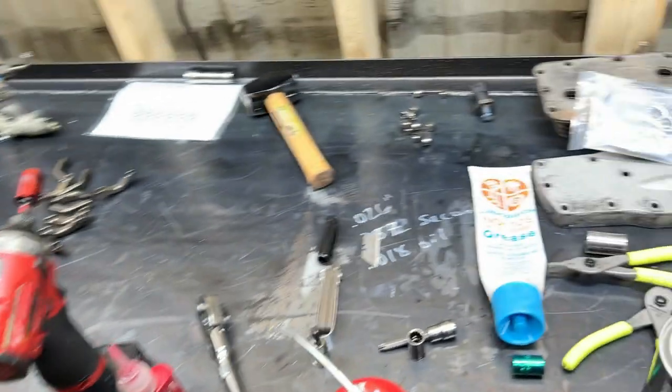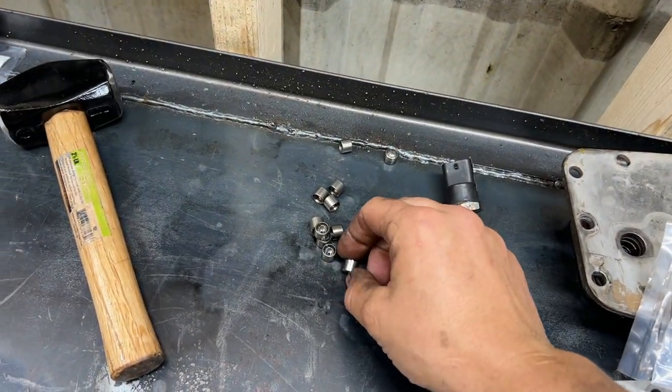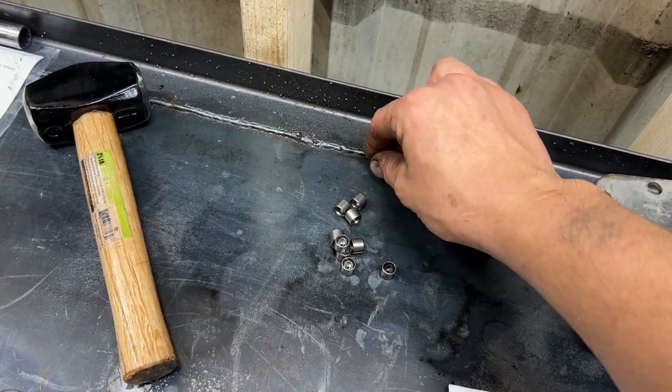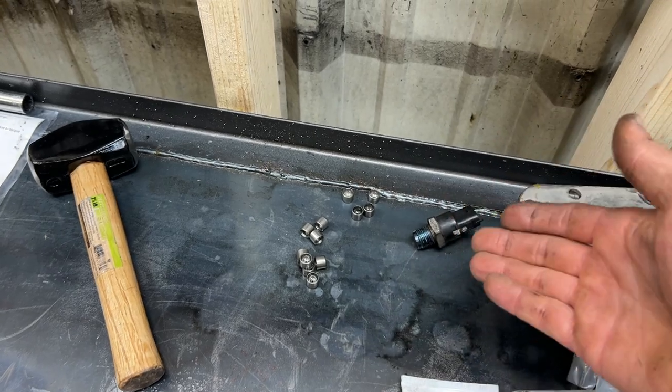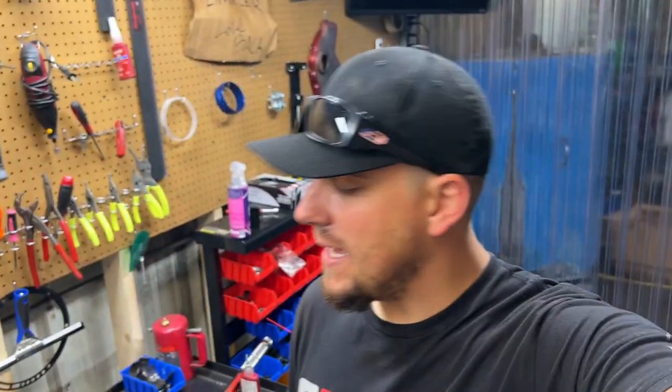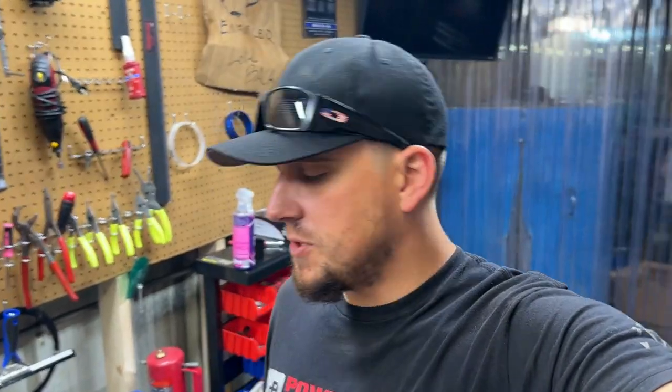We found the push rod tips all broken off, which is extremely common on the 5.9 trucks. You guys can see there, I have them all. I said, hey, I'll put it together like that, but the first time you go to do injectors or valve lash, these things love to pop out. This is the version that had the plastic clips. We gave them the option. I told them, find a set that's used, like on a fire pump forum or whatever, like a late 6.7 that is steel press fit. I don't care, I'm happy to do that.